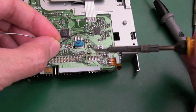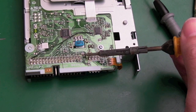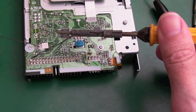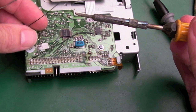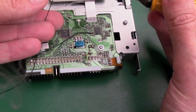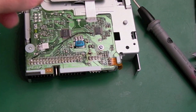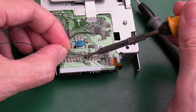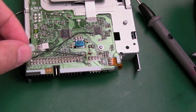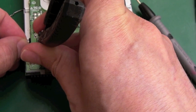So there's a couple of pads here. The bottom one, we need a wire. Yeah, so get some solder there. We need a wire from there to the top of these two wires here, the one that's nearest this 3-pin motor connector, I think it is there. It might be a sensor or something, that little white flex ribbon, but I suspect not. I suspect it's going to a motor. So let's just trim that down again. Solder our second wire here. Yeah, that's that. Stretch it across again, and just trim it off so it's the exact length there, I think.